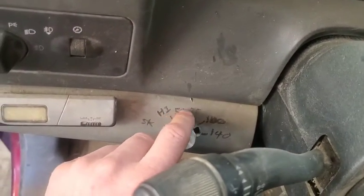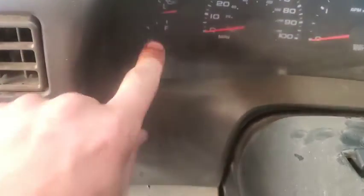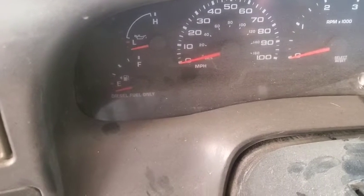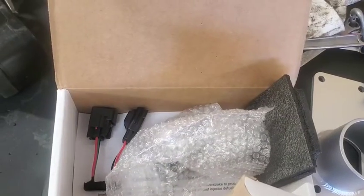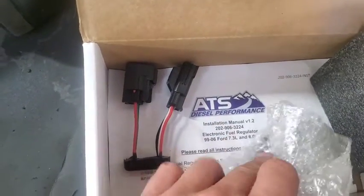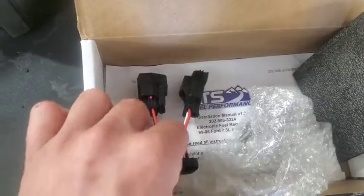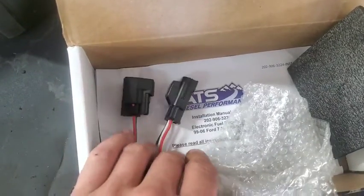we got this, and like I said, I run it on 50 a lot, and even then sometimes I'll trip the check engine light. I'll have to look up the code that I possibly get, but it's like an overboost code. It's part of the MAP sensor, which is the other reason I got this boost fooler thing that's going to hook in series with that MAP sensor and the ECM.